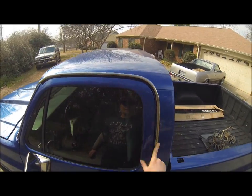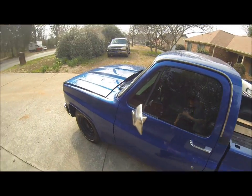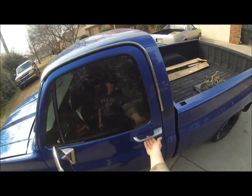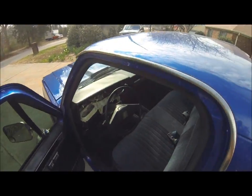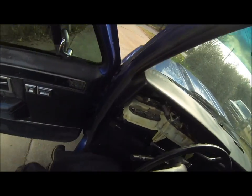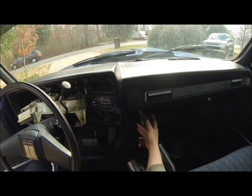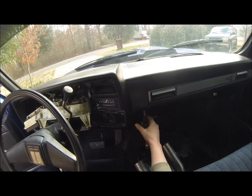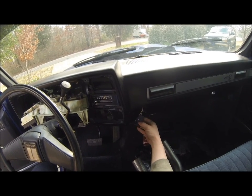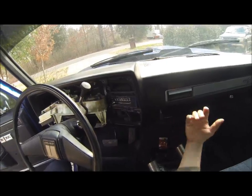The rain gutter was missing on this side — I put that back on. When I first assembled this engine, I found the main problem: it kept dying off as soon as you would crank it and I thought it was a fuel injection problem. Turned out it was this switch right here — it had a bad connection on the inside creating resistance and getting real hot. I got in there and cleaned it out for now; I'll probably replace it in the future, but it's running like a champ now.